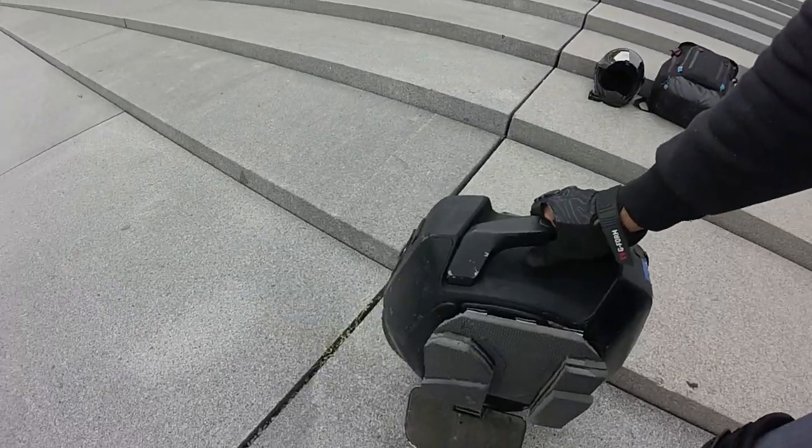That is really disheartening for me because I've grown to love the Gotways where if you happen to push the cutout switch, it doesn't just cut out. What happens is it dips and gives you — maybe even 45 degrees — before it actually cuts out. So you have plenty of time to back off from a cutout. Whereas this one: immediate. InMotion: immediate. But at least they have the tilt-back feature. Gotway does have a tilt-back feature as well, but only up to 30, maybe 31 miles an hour. I've tried it at 33 — it never worked. The Gotway app I had back then maxed out at 30 miles an hour. EUC World you can range that up as much as you want — I tried it, it didn't work.